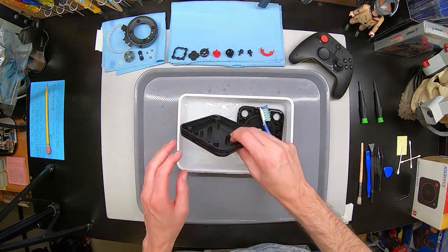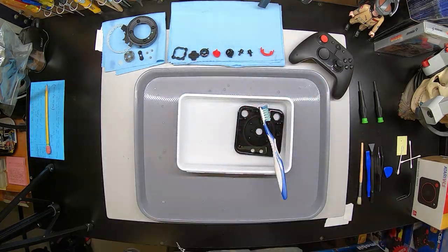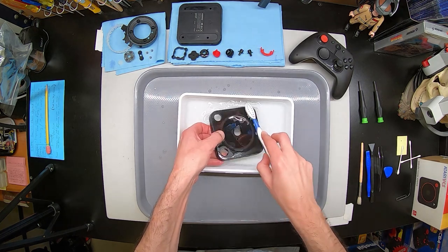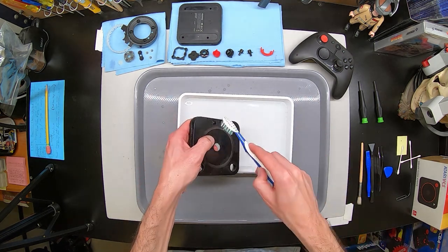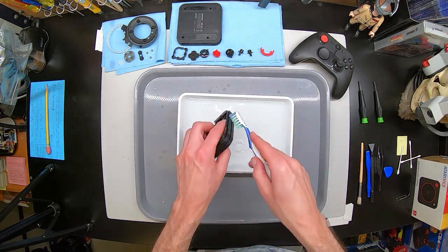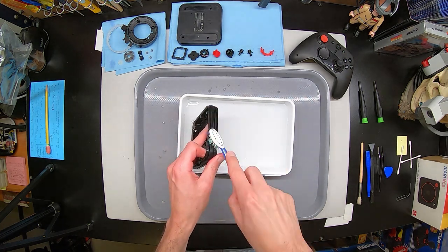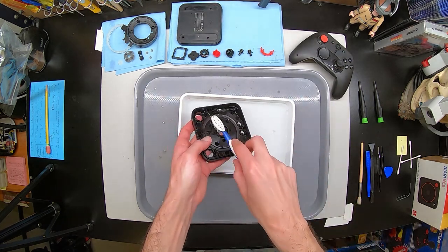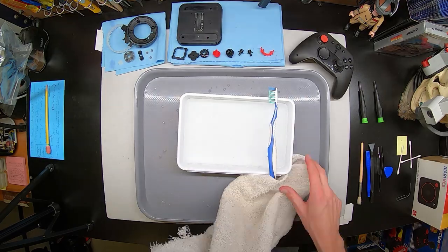I was thinking the same thing on this joystick, actually. I thought I might have broken it, because it was starting to act a little funny — my diagonals weren't reading very well and I was starting to get hung up. What I find is that cleaning the contacts does work. And the little tab that was floating around in there — I have a suspicion it was getting stuck underneath the joystick, because every once in a while my joystick would get stuck. Now that the piece isn't floating around inside, that is not happening and the joystick has no problems at all. There is a tab to the side that actually holds that piece in, in addition to those four tabs underneath. So if you're breaking yours, as long as you clean out the parts, you should be okay.